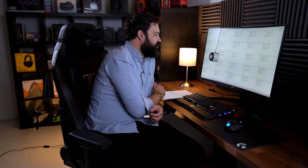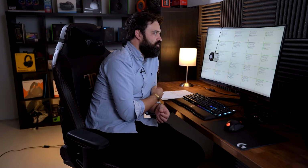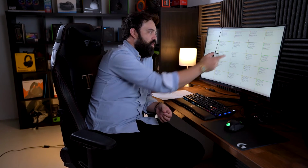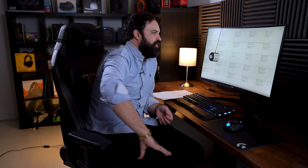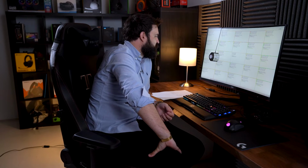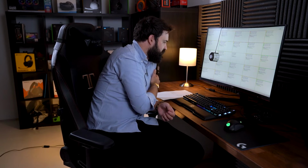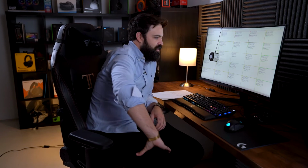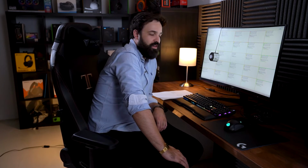The brightness across the board was pretty good, but again in these two squares you've got under 15.2 candelas. On the right is 11.73. Funnily, that isn't the worst on the monitor. There's worse ones. This one down the bottom is minus 26. This one's minus 16, but overall these are red because of the colour deviation. They're just the worst colour. Those were the scientific readings.